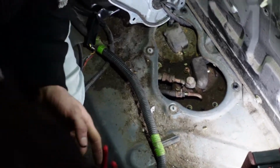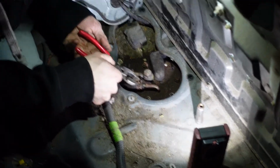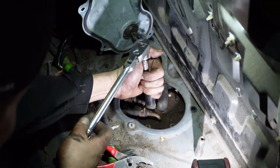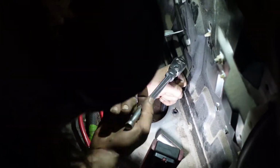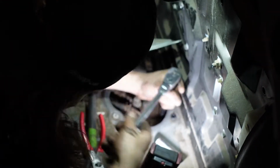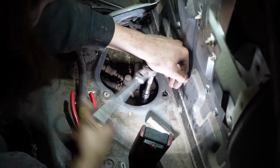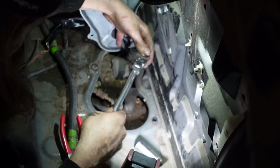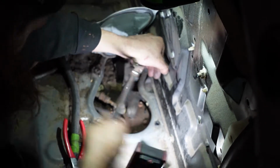I want you to have a fuel leak under your seat. No, dude, I think that's the smell. Just getting high on my own supply. Feels good to drive. I don't know why, man. Got that brand new fuel pressure regulator in there. So I'm gonna dial her into 43 pounds. A smart guy would just fire it up to see if she goes, but that I'm not. We're not made out of money over here at TNS Media. But damn it, we're trying.